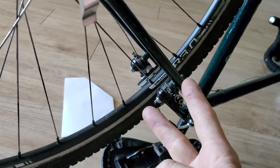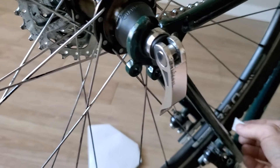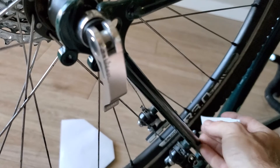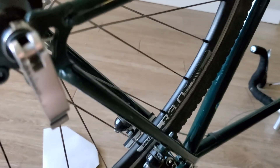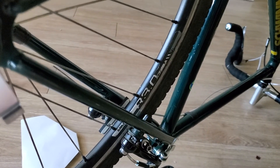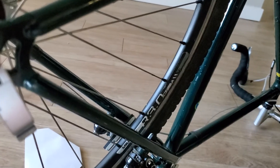The two is to check your up and down, and you want to do that with the tire off, or with some kind of reference point right at the edge of the rim that you can see — like this neat little jig that we have. If it's got any wobble, having a stand to do this will really improve your results. You want to take out any up and down motion because that will throw you as you go, and you'll lose a lot of energy — and you can wreck your rim real quick. So the third one is just balancing back and forth so you don't have any wobble. Then you always check each one again. Finish with truing and then ride that bike.